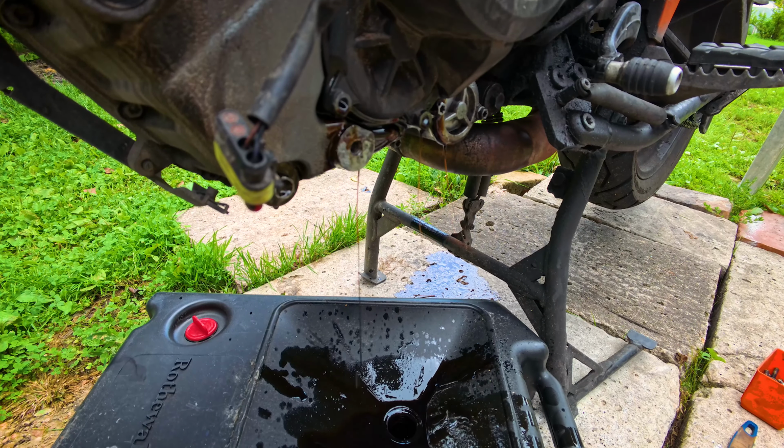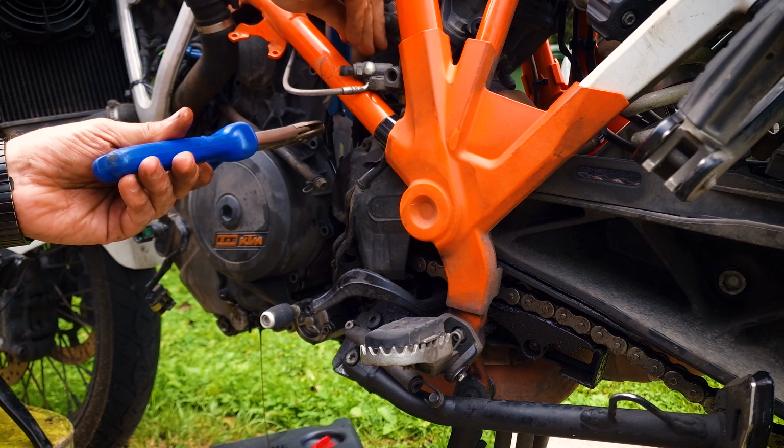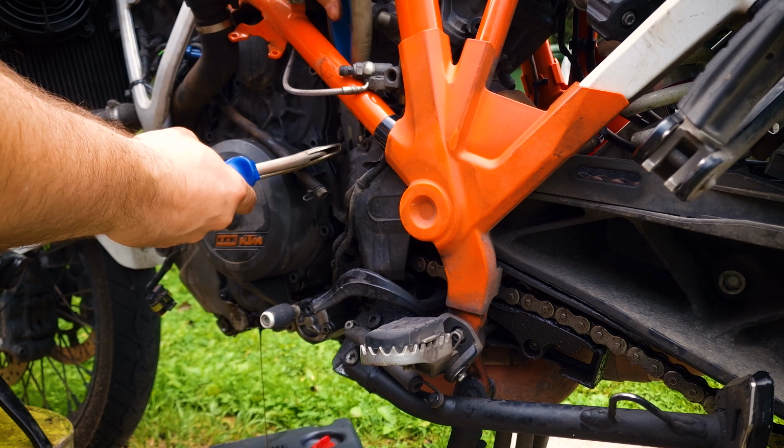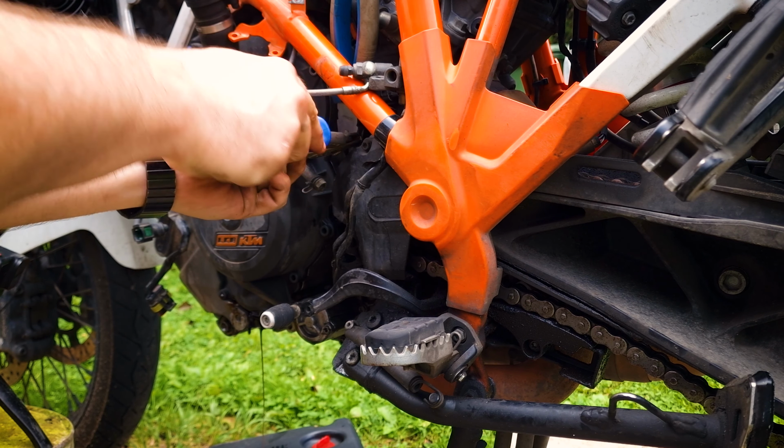In order to remove this cover in the service, there is a special puller. It looks like a sleeve that is screwed into the thread in the middle of the cap. There the thread is covered by a plug. A long bolt is screwed into the bushing itself. It rests against the alternator rotor and pulls the cover more smoothly than by hand.